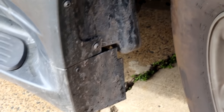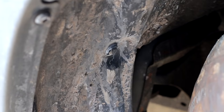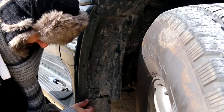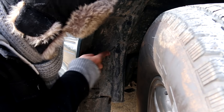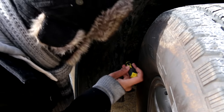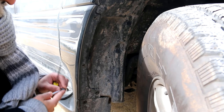The antenna motor assembly is under the passenger side front wheel well. What we have to do is take off the plastic tabs that are holding that shroud in place. I ended up breaking most of mine, but luckily I ordered more on Amazon knowing that would happen. I didn't really need to remove the Torx screws — I ended up not needing to, but I did anyway. These clips — you slide a flathead in and pop the little tabs out, but they usually break off. I end up pushing the pins in, and once they're in you can pop the plastic off, but they usually end up breaking.